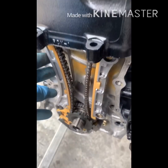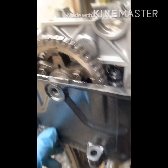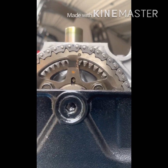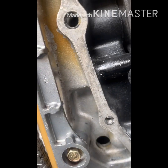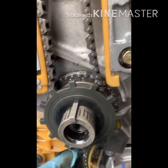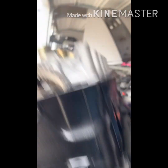The more you know. So I still have the timing chain tensioner in there, and when the chain is tight — see that tick mark right there on the timing gear — didn't get any better than that, so we're good to go. I can reinstall the timing chain cover, put more Honda Bond around it, up here, here — all the way around. New oil pump chain, new timing chain — up and in.